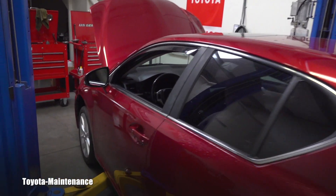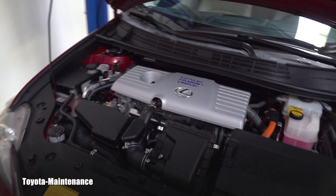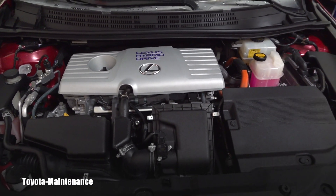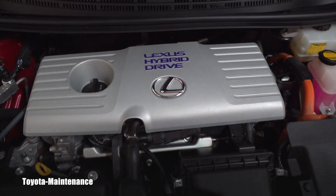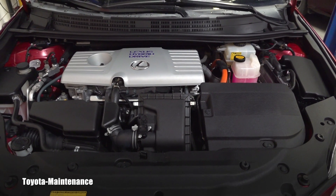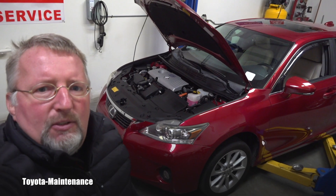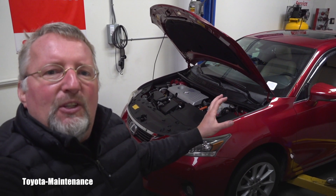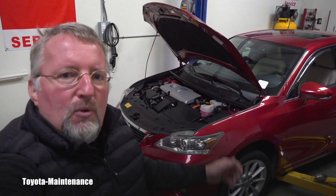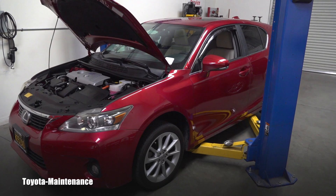There was also a slight overheating which happened once. It was a brand new owner and it was obvious that somebody was trying to repair it, didn't succeed, and probably traded it to a used car dealer. After removing the cover, we found two different sets of spark plugs — both incorrect — and two aftermarket coils on two of the four cylinders. Clear proof somebody was dealing with the same misfire problem.